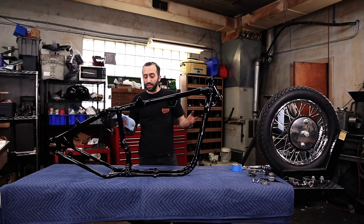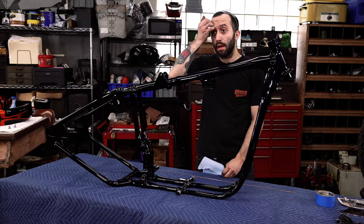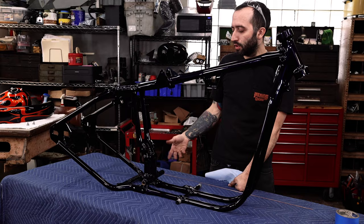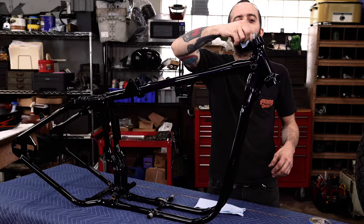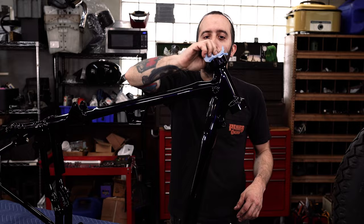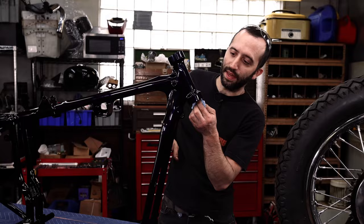So the first thing you're gonna wanna do is clean off any surfaces, say bearing surfaces or bushings, where paint dust or overspray or anything like that could have gotten into those surfaces. Paint booths are often pretty dirty with stuff like that, so you're going to want to wipe off all your surfaces, definitely bearing races and bushings alike, any kind of interior hole that something's going to slip inside of. Some of those places are just a little difficult to keep paint dust out of.